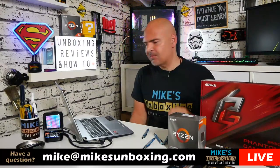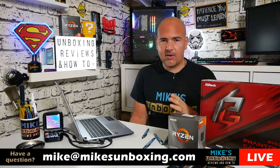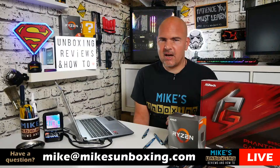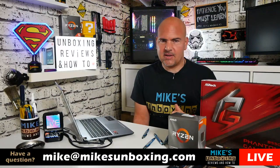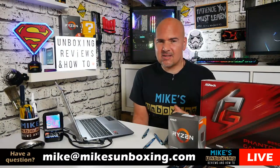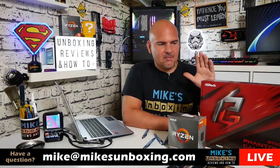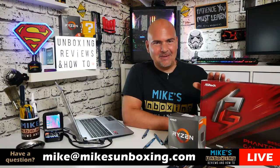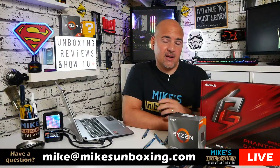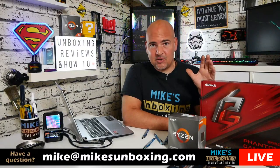So, where was I? Oh, yeah, the Phantom Gaming board. This definitely is an upgrade over the Pro 4. So, if you're looking at building a system at the moment based around AMD chips, I would say up to probably a Ryzen 7 3700, maybe a 3800. The 3900s, it's a slightly different ball game, and really, if you're spending that sort of money on a processor, realistically, you don't want to be slumming it down here with us in the cheap seats and getting yourself one of these. You want to spend a bit more money, a board with a bit more of a feature set. And really, I suppose you'd be going X570 rather than B550, because this is a cheap board.